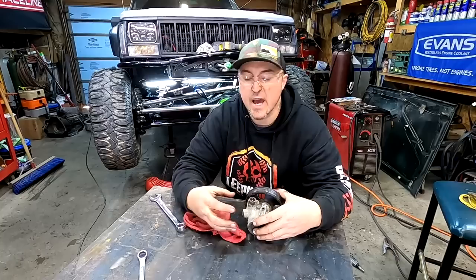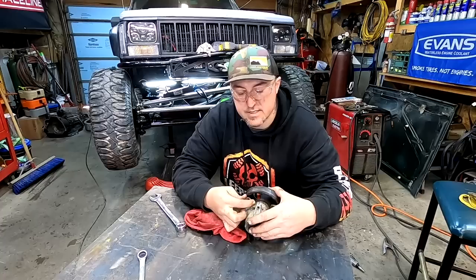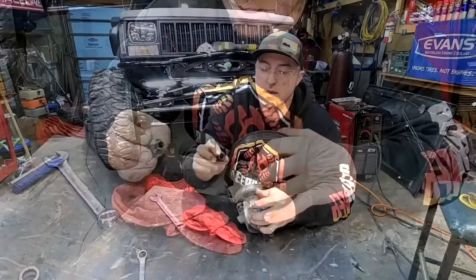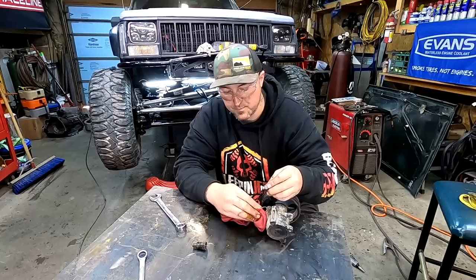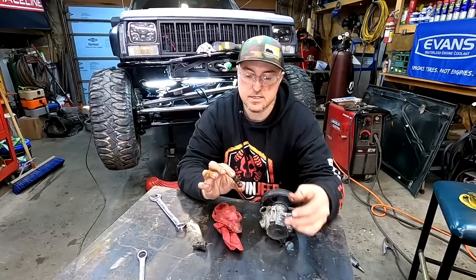You can buy a better pump, or if you don't want to mess with yours, consider using a 1.5-inch ram instead of a 2-inch ram — it takes less volume. I'm going to push the pressure up a little and push the volume up a little. I took the reservoir off just so you can see. All you do is take your line off, then use a 7/8 socket on the piece that holds the spring in. Inside you can see the opening that we need to open up just a tiny bit.